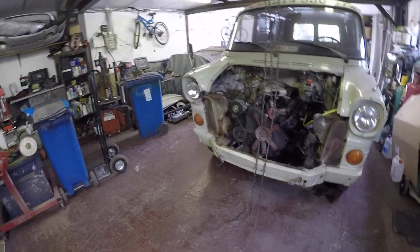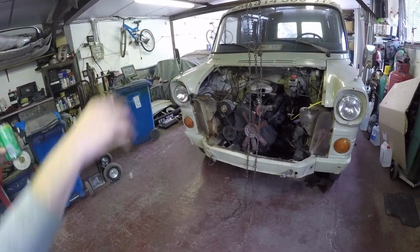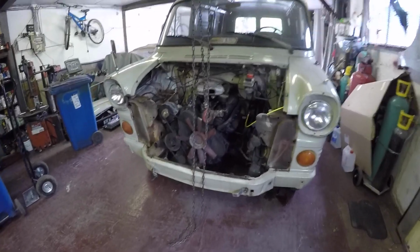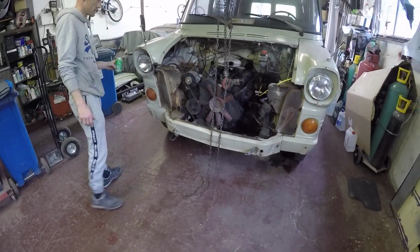Look at that. It's gonna be well easy, isn't it? Whip that out, take the gearbox out separate. All you're literally going to have to do is lift it a couple of inches, and then just push the vehicle back and it'll be free. Then I can get the gearbox out as well. Get exhaust off and gearbox out. Should be alright, shouldn't it? Happy days.